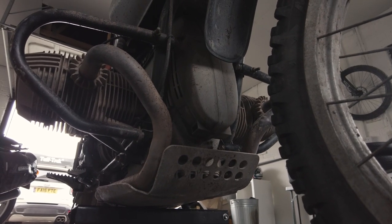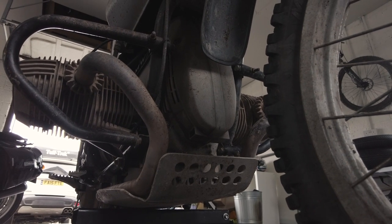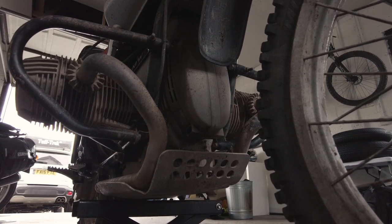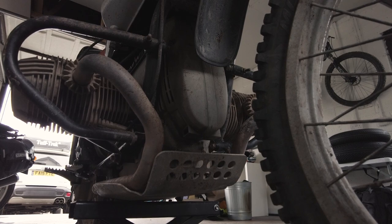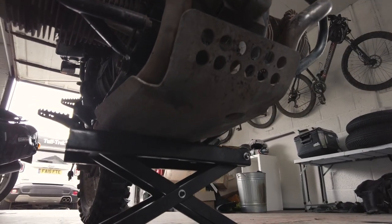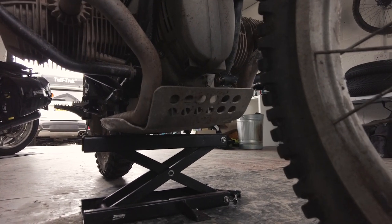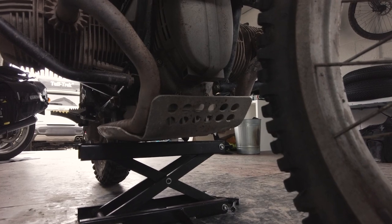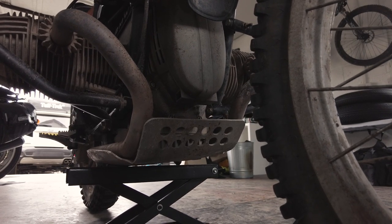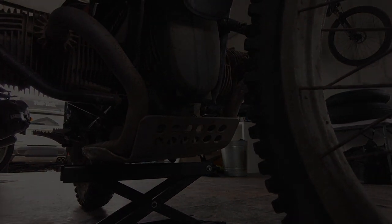This bash plate — I think it was from BMW Bayer, though Motorworks may have them in the UK now. There are a couple of standard bash plate options; I went with the larger one as the thinner one didn't really protect the exhaust. To fit these to an ST you need to change from the ST sump, which is deeper, to a GS sump. That gives you the four mounting bolts for the bash plate. If you do get that sump you also need a shallower oil pickup and you'll need to adjust the length of your dipstick, as you'll be carrying a little less oil.